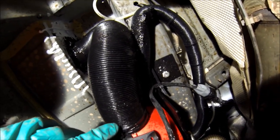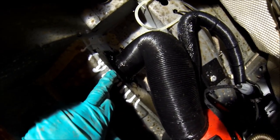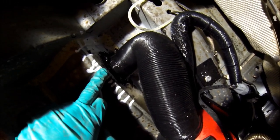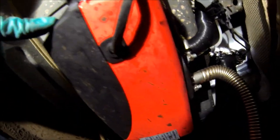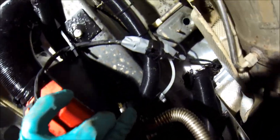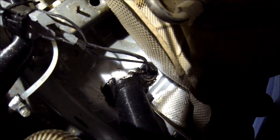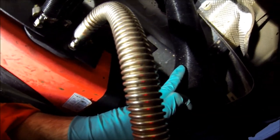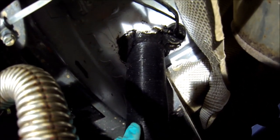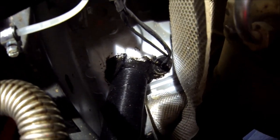That's where the fan cold air inlet is — go underneath and I'll show you where that comes down. So underneath the vehicle, on the right hand side, this is the cold air inlet for the fan, and this is the hole I made in the footwell which I just showed you. It's just mastic to make sure no cold air can get in. The exhaust is going to run down and I'll put the plastic trim back on later with a hole cut in it. The combustion air inlet is this one here, just routed and nestled up there. The wiring loom runs through the standard grommet underneath the driver's seat, and this is the hot air into the cabin — I've used high temperature mastic sealant so it's nice and airtight.